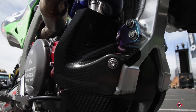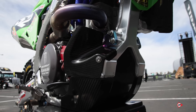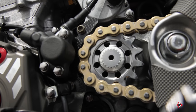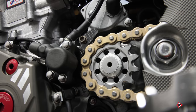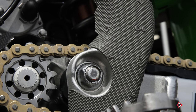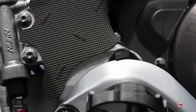We outsource for our carbon skid plate, designed in-house, to provide the best protection for the ignition cover, water pump, and everything else. We drill a hole and run a rubber grommet through to keep our overflow hose in check instead of it flopping around. The case saver is a PC product as well, bolted on with aluminum bolts — we want the case saver there to protect the cases, but in the case a chain comes off, the aluminum bolts will break away and make space for the chain. Our swingarm pivot is titanium, and we run a plug on the end so mud can't pack in. On the other side, we have a brake pedal stop so if the brake pedal gets hit up, it doesn't rip the guts out of it.